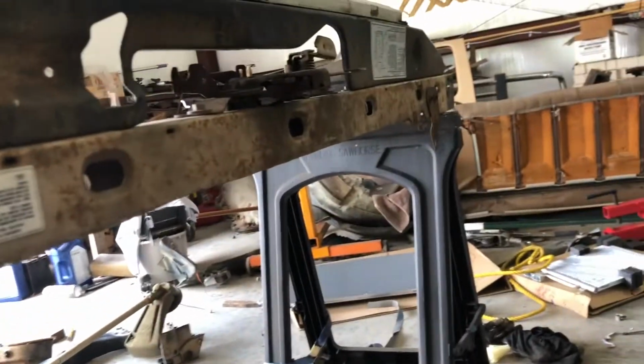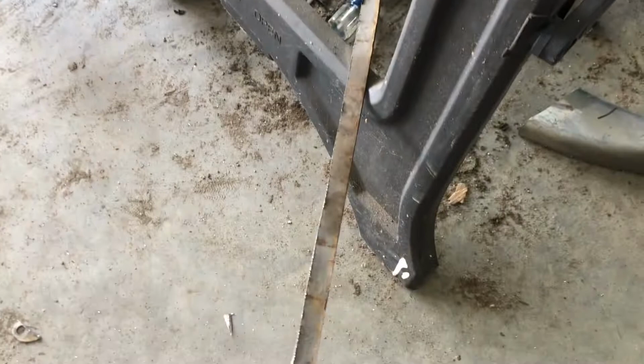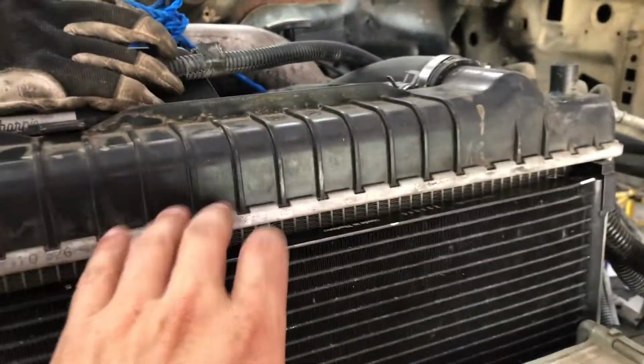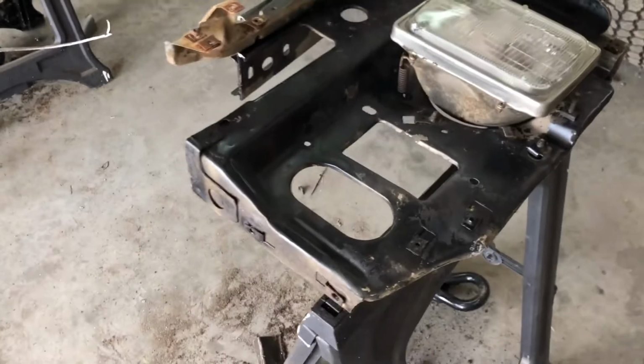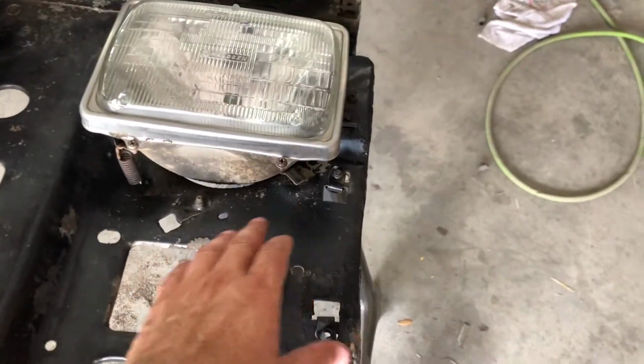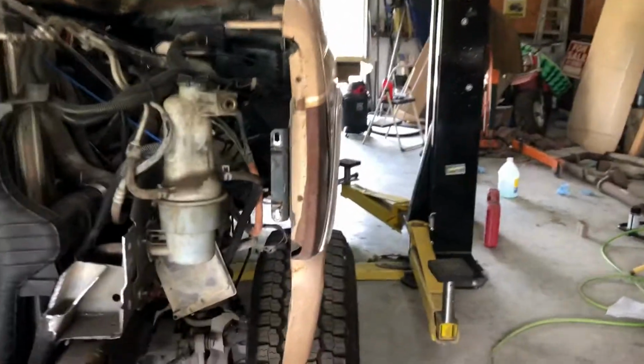And then I cut a little bit off the front lip. Probably about a quarter. Well, let's see, I got the old piece right here. Probably about 1/2 inch to 3/4, just so it will fit snug up against the radiator, or actually it'll back off of it, give a little bit of a gap. But so that's the old radiator support. I still left all these pieces in. These go where those two brackets are, or where that bracket is. So those two go there to suck it up against it.